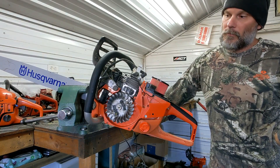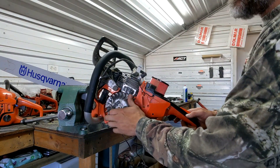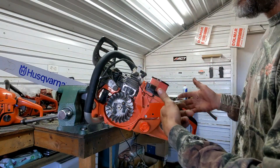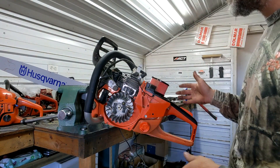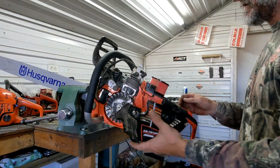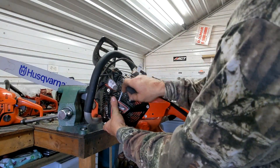But I will show how I figure it out. I've got a mark right here and a mark on the flywheel so I can see about where top dead center is. That just gives me an idea in relation to where I'm going to be making my marks on the side of the saw when it's running. This will be loud, so I apologize in advance, and it's also kind of a pain to start them like this, but we make do with what we've got.